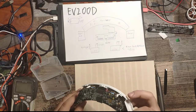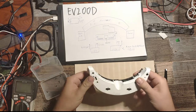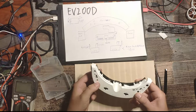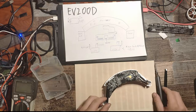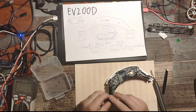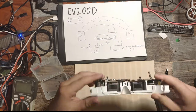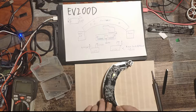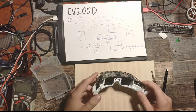Check that it went in — it didn't quite work yet, because it's not all the way in. You can see there's supposed to be a switch visible here and it doesn't show yet, so push it a little more in. You have to be quite careful at this step not to break ribbon cables. Now I can see the switch — so it's all the way in.